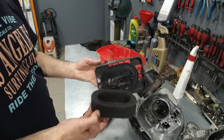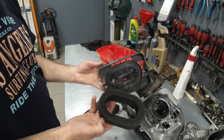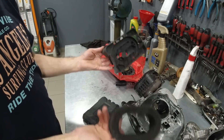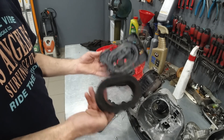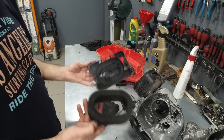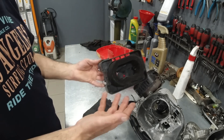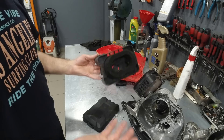If the manufacturer of this motor had installed a paper filter here, this motor would be much better and more durable. I don't know why they don't do that — I really don't know. But in my practice it has been shown that this is a fairly poor motor, only because of this filter. It seems to me that in the future it will get worse and worse, and that regular servicing — like oil changes — may not even happen. Perhaps in the future this will become a disposable part.